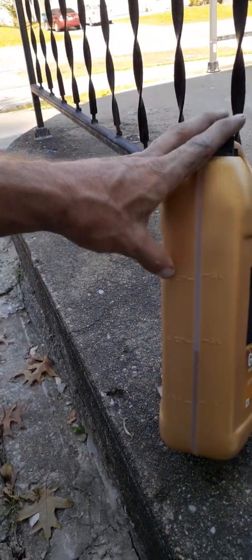Another tip for fall and winter: a lot of people don't realize that these little grooves in your tires are what stop you on wet pavement. Even if you have a quarter to half inch of tread depth, if those grooves are gone, you won't stop. I had a Z28 Camaro and found that out the hard way — the tires looked deep but it was sliding all over when it got wet. Check your tires this season because who knows what the weather will be like.